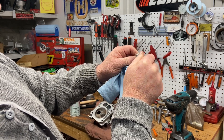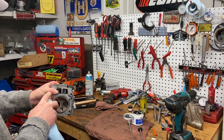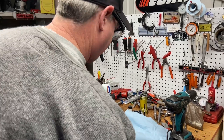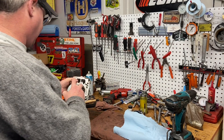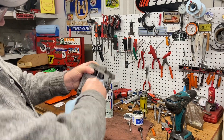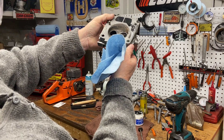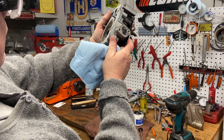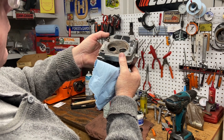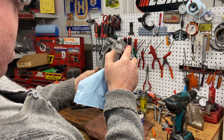So that thing's touching all the way around. Now let's look at our valve seat — get a little brake clean on that, a little bit of air, and wipe it too with more brake clean just because. Okay, that seat to me looks like it's touching pretty evenly all the way around. Yeah, I think it's pretty good — I'm going to give it a little bit more.